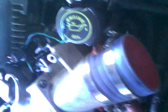I went ahead and took the line, got back there with the vacuum on of course, and sucked all the debris out right there. You can open the butterfly to get a little more airflow if needed. Then I went ahead and sent it down through the throttle body and tried sucking it up, which worked okay. Realizing how big my throttle body is, I just went ahead and pulled it off and sucked down the throttle body up to the opening to suck any more residue out.